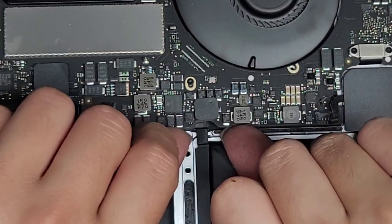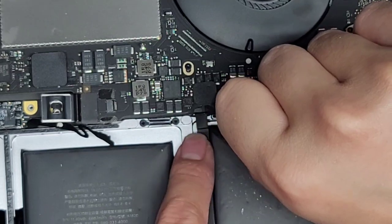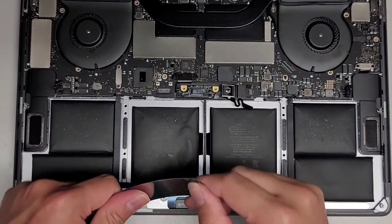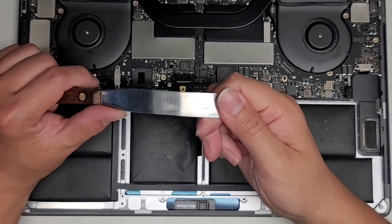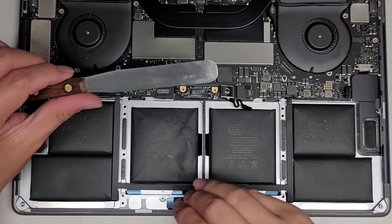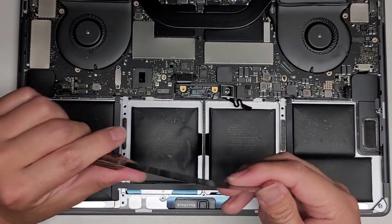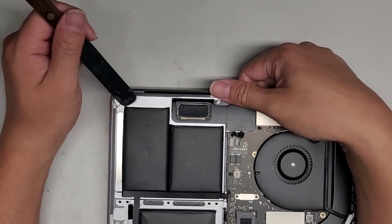Let's see if that helps lift it more. I don't want to remove everything in here, so I'm going to remove the minimum. Now I can kind of lift up here. I'll do the same on both sides — also need to disconnect the other speaker cable. Get underneath to scrape up the adhesive, get as close as possible to the connector, pry up at the plastic, and there we go. Now we can lift it a lot higher — we'll get some cards under here to hold it up enough to slide the battery cable out.